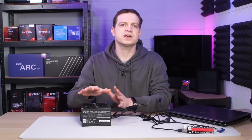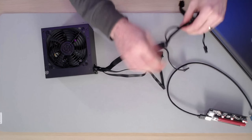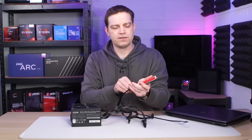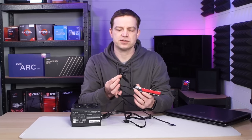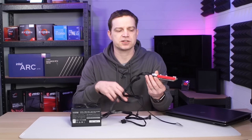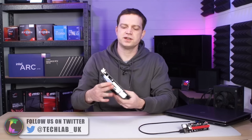Normally with a standard power supply you'll have your 24-pin connection and you'll need to jump the cable to get it running — that plugs into the riser card to give it power. If you're using a graphics card that requires additional power via plugs on the card itself, you can use a pigtail or you'll want a power supply with more PCIe connections. It's worth making a note of that because you'll need the right power supply.